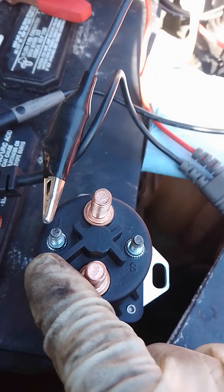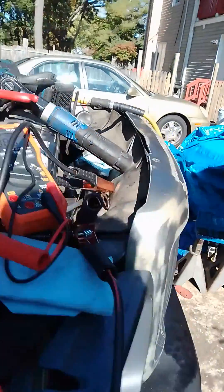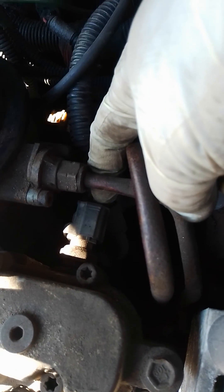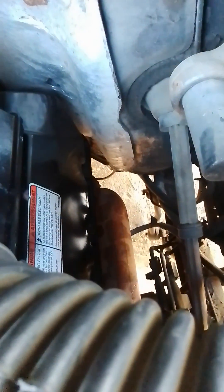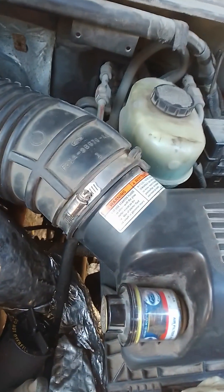This other terminal is going to be hot because of the way this thing works with the oil sender in this unit. This sensor here — I'm touching it — that's your oil temperature sensor. And back here on the intake you're going to have the intake air temperature sensor, and that's just for measuring how hot the intake temperature is.